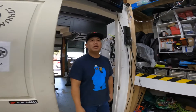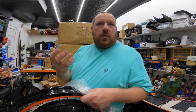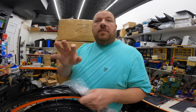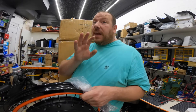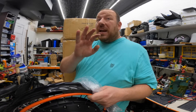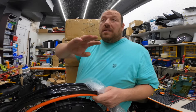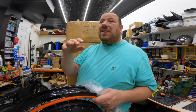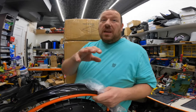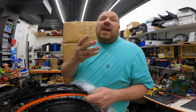What are you doing? Printing labels — it's very important to say: the stock controller, the Kelly, is rated 300 phase amps. It's not rated 300 DC amps. There are some people out there claiming they have tuned their stock motor controllers to 20 kilowatts — that's a lie.